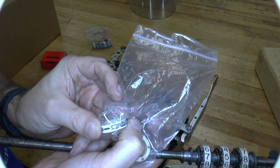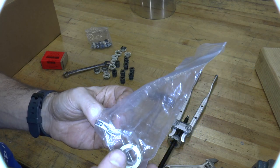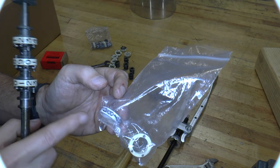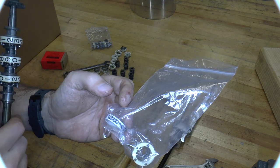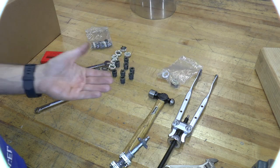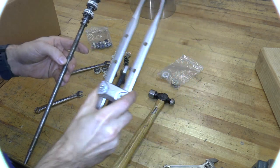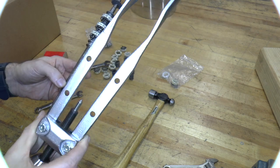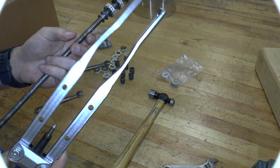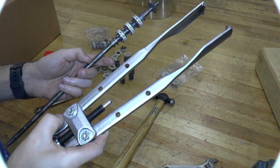It's bad enough that I ruined one of the digit wheels and had to replace it with an awful looking 3D printed version. The paint didn't come out that well — the best thing probably would have been to paint it white, put a lacquer coat on it, smooth that down, then put the black paint on and rub it off. But it's functional. So what I'm probably going to end up doing is just making some longer bars for this — it looks like iron or steel, so I can make one of these. Hopefully after the break I will have a new set of jaws.